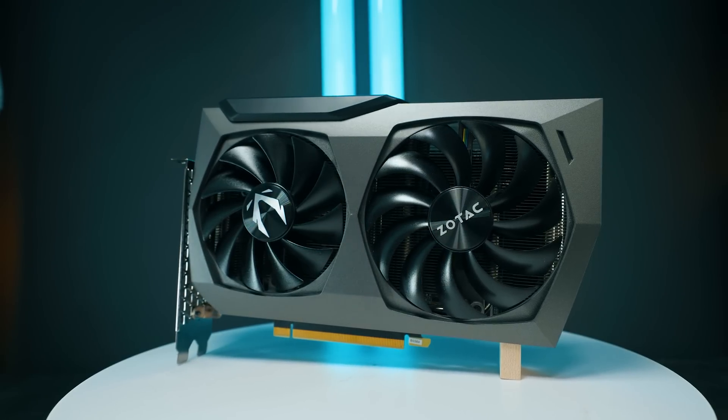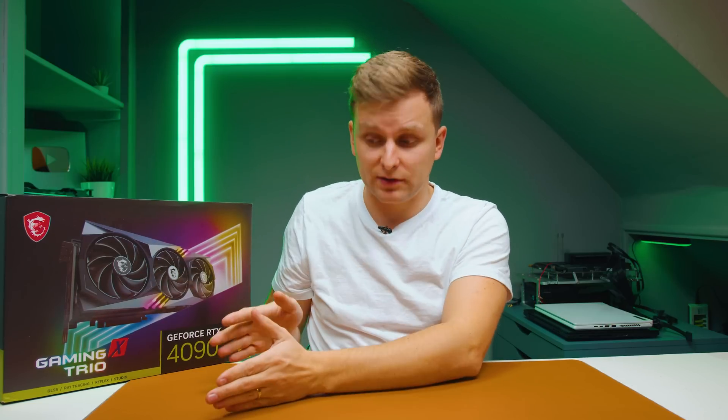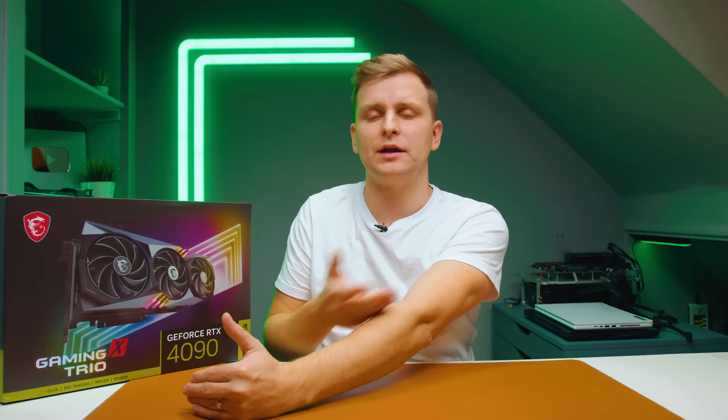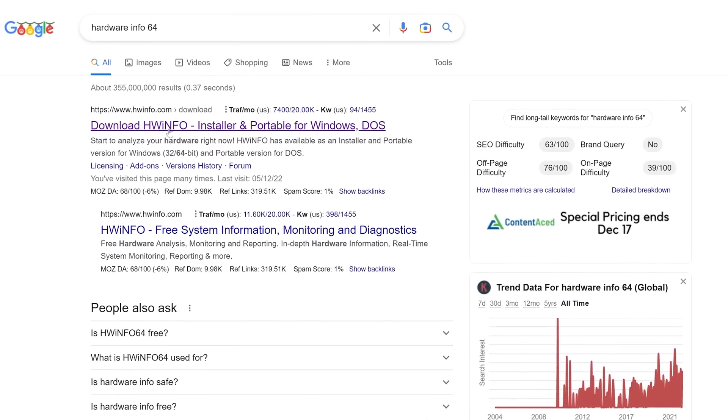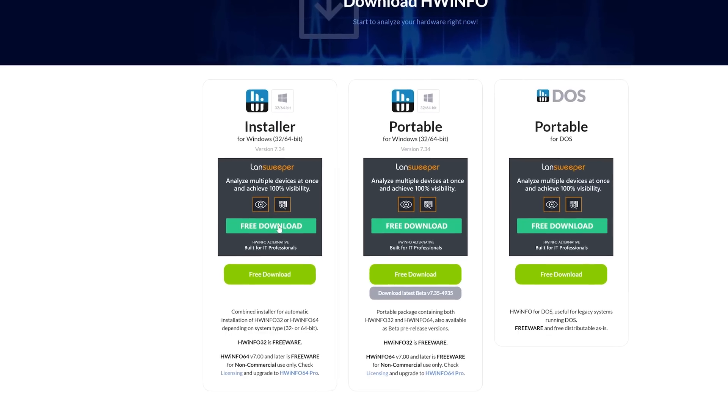Number one: VRAM. Previously I was using an RTX 3070 with 8GB of VRAM, and our timeline was often lagging - pausing took forever to load and unload. Using HWiNFO64, I quickly realized the VRAM was bottlenecked and we were using more than 8GB. If you want to check whether you're bottlenecked by VRAM, download HWiNFO64 - it's free. Let it run during a full day of editing and check how much VRAM you peaked at.